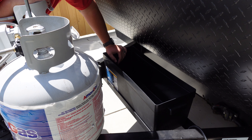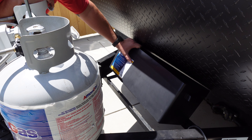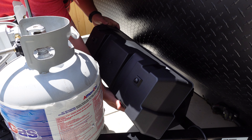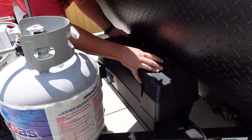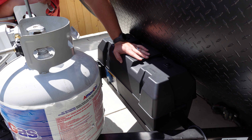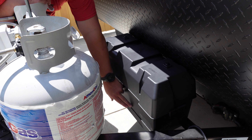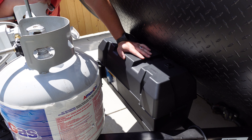Here it is — this is the Camco double battery box. It's good for 12-volt and six-volt applications. It holds two six-volt GC2 batteries or two 12-volt group 24/24M batteries. The real question was the lid shape, and this lid has a little bit of a taper to it. On the back end it touches slightly, but the lid snaps into place and goes on. I think this is my solution. If it ends up rubbing too much, I'll move the bracket, but for the everyday person trying to convert to two six-volt batteries, this will do it as long as you have ample space.